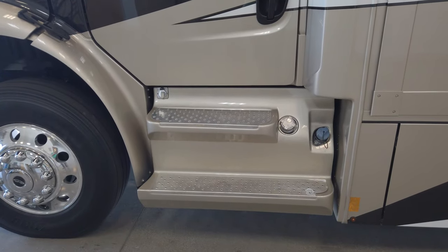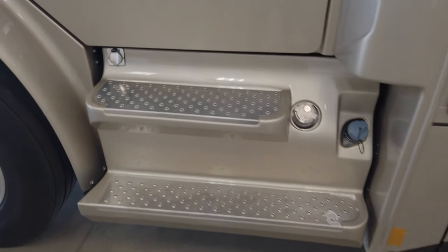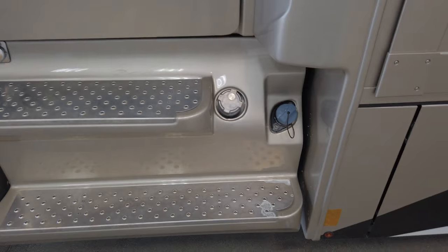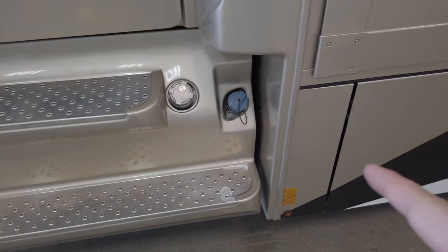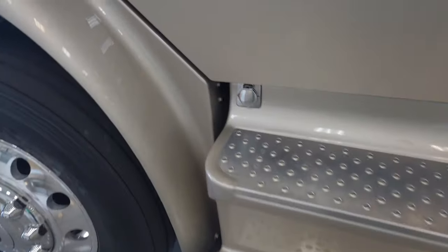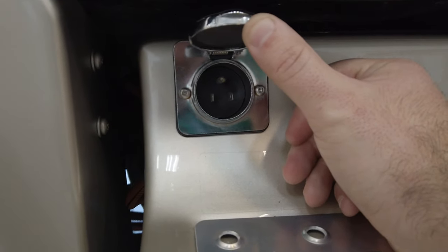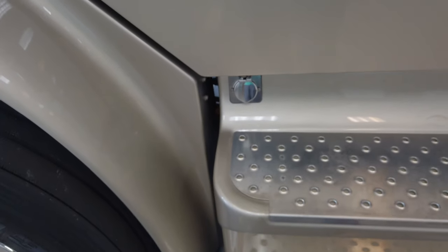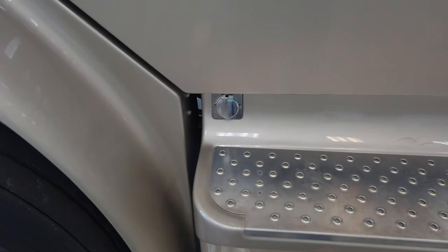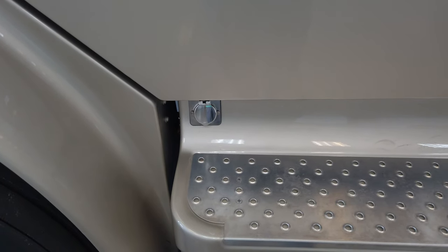Here's the driver's side with the door. Here's our straddled 50-gallon fuel tank — there's your fuel cap for the driver's side and your DEF cap over here to fill your DEF tank. Underneath the door, this plug, which is a 15-amp male, is for plugging in your block heater to keep your engine warm. Modern diesel engines today are pretty good about starting in cold weather, especially with the intake heaters — you just have to let the key turn over and let the grid heater warm up before trying to start the motor.